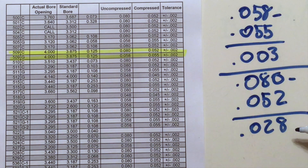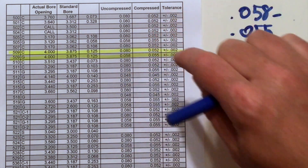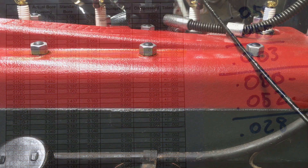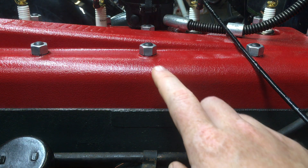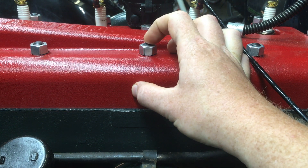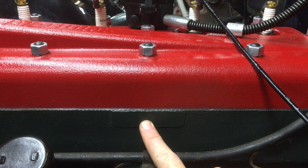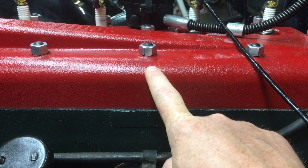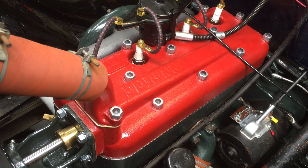And that means to take all the slack out of a copper gasket once it's compressed, you've got to give more than half a turn — 200 degrees of turn — to the head nut to get from uncompressed to compressed state. To recap: the reason that gasket re-torque or break-in is so important is that between embedment and creep and other factors — like the head warming up stretching the stud by another thousandth of an inch — all those factors taken together mean you can lose 30% or more of the clamping force on the cylinder head after a single heat cycle, especially with a copper gasket. The solution is to do a controlled break-in.